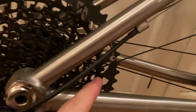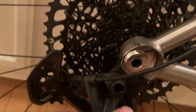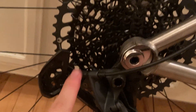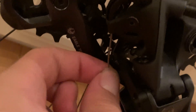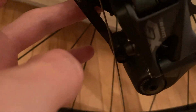The last piece is now installed going all the way to the derailleur. I cut this piece long enough to allow the derailleur to swing back and forward fully — that's how you determine the length to cut this cable surround. I threaded it through the hole at the top of the derailleur, wrapped it around the pulley, and now we have just raw cable coming out. Next step is to lock the derailleur using the little lock pin button down here.